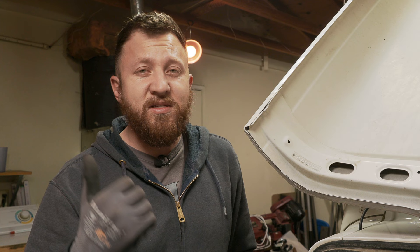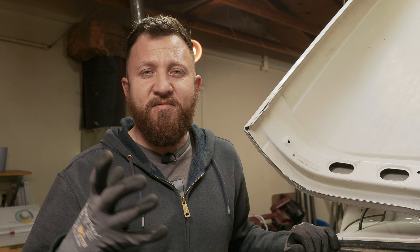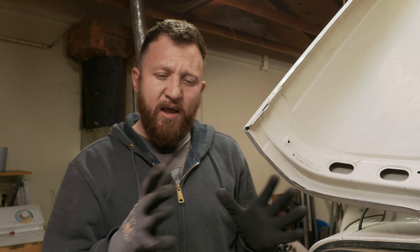I've had to remedy a few problems in the past. I've done many parasitic draw tests — there's always none, or at least nothing above normal. There's only a little bit because you have computers and stuff, but nothing above normal. I did have to replace the computer because Jeeps — Chrysler specifically — have the voltage regulator built into the computer. When that goes bad, funky things happen. So I had to replace the computer to replace the voltage regulator. I've got a new alternator, so everything is tested and working correctly. But the one thing I found out was the voltage — or rather, the lack thereof.